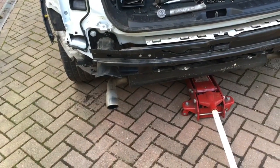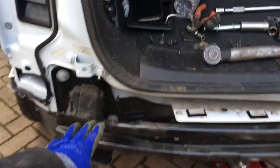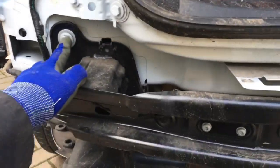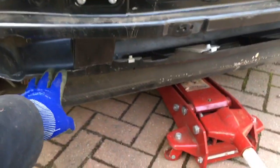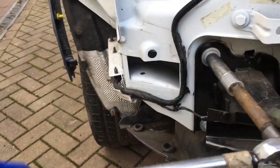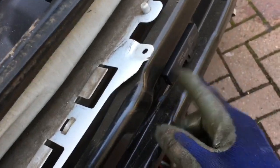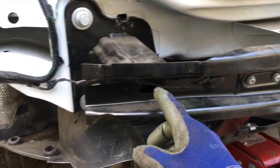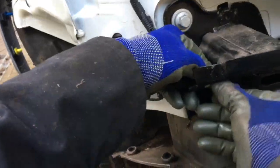Back to daylight — that was about two hours of work to reach this position with the bumper off. Two more things to remove: the rear structural beam, held on by bolts requiring a 15mm socket, and the under tray. Note there is a sensor — probably a crash protection or airbag sensor — attached to this torsion beam.